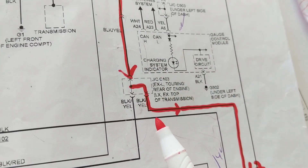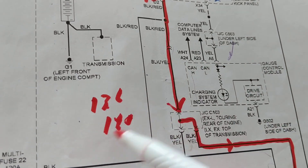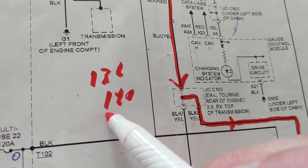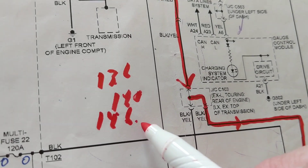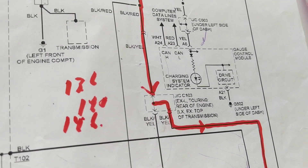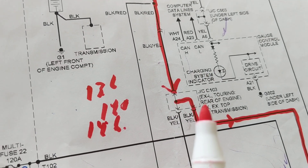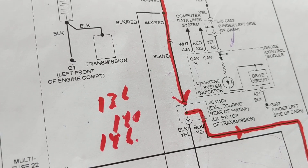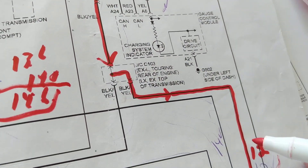Once you crank the car — engine working, pulleys turning, serpentine belts turning — the alternator is happy and giving an output of 13.6 to 14.5 volts. The colder it is, the higher the voltage will be; for example, at 10–20 degrees, temperature compensators might push it to 14.6 or 14.7, but as it warms up it drops to 14.2 or 14.3. The important thing is getting a stable output regardless of what accessories are on.